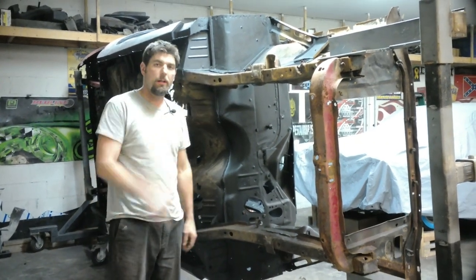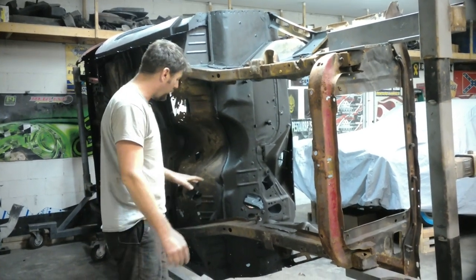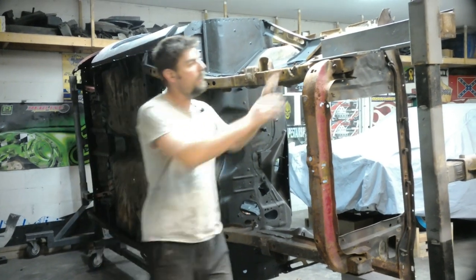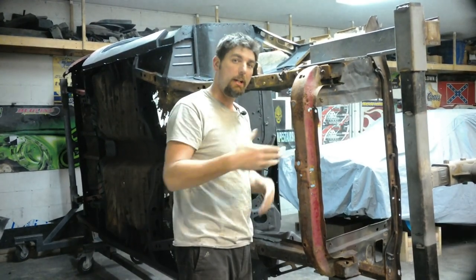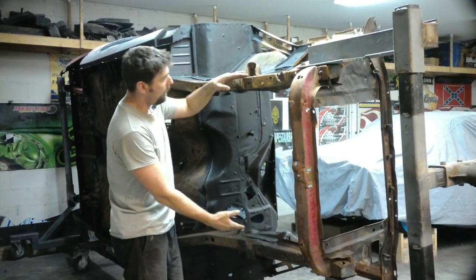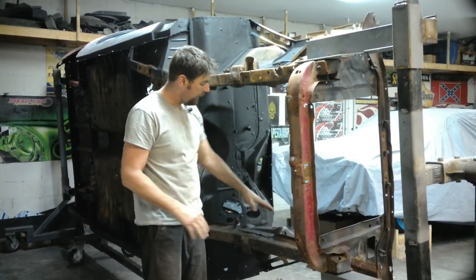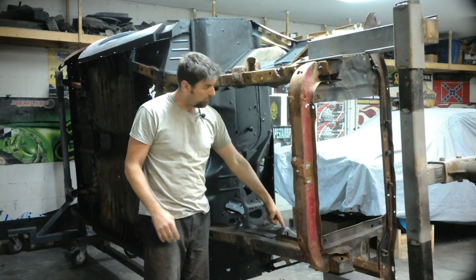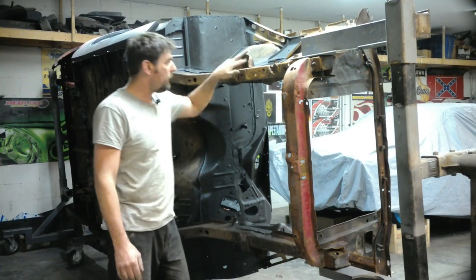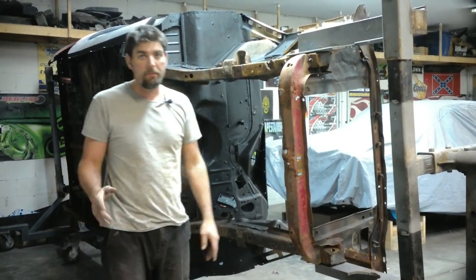On this video, we're going to get our 73 Challenger onto a frame jig. If you watched the intro, you've seen this car is pretty wrecked out in the front. We've got a couple frame rails that are bent. We verified on some measurements that it's actually a little worse than we thought. The frame rails are coming in a quarter inch, and the shock towers at the top where the bolts are are also angled in — probably about a half an inch in. I'm going to show you how we verified all of this.